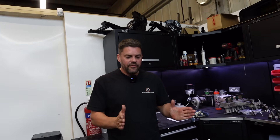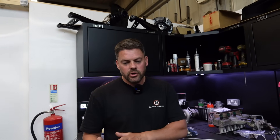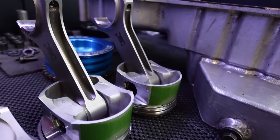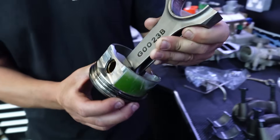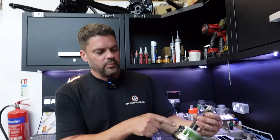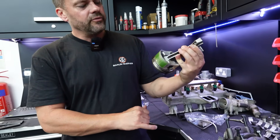Not only has this got everything in it it was supposed to have, but it's better than I actually thought — which has shocked Russell and I. It was meant to have Cosworth pistons, forged H-section rods, long rod setup. So you've got the long rod with adjusted pin height to the crown of the piston. Sure enough, we do have that. We've got Peck rods — H-section rods — and it's the long rod setup, so these rods are longer than standard. These are the Cosworth pistons, which are pretty much visually like a copy of the original Mahlers but made by Cosworth. It's a pretty old piston and I know that because I've seen that part number before, but it is a long rod setup. The piston pin is further up towards the crown. It's got the trademark green Teflon coating. Done very little work, I think. Could do with a set of rings.